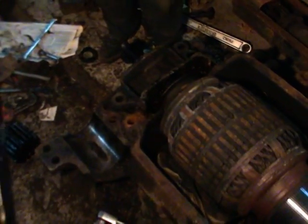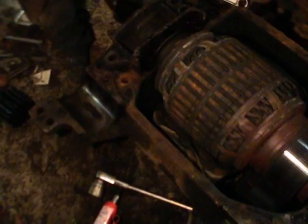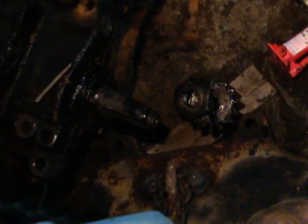The one for this next one over here was very, very tight, and we had to take it off with a device that looks like this, and I have some pictures of that. You can see it operating. It's basically like a champagne cork puller, goes over the gear, and then you turn it up tight, and you take a big sledgehammer and whack on the end of it as hard as you can. After doing that for about half an hour, while keeping it tightening, it eventually pulls the thing off, and it comes off with a snap.